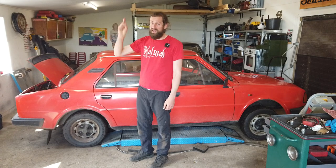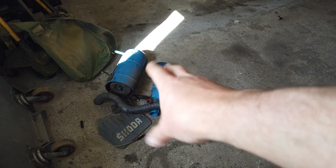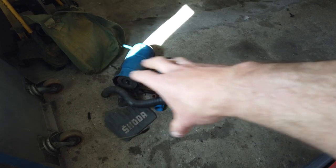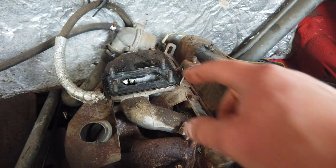I've already taken off the carb and the fuel pump. This means the airbox has to come off — one wire, a breather for the crankcase, and a heat tube from the exhaust for cold start. Then I removed the carb.